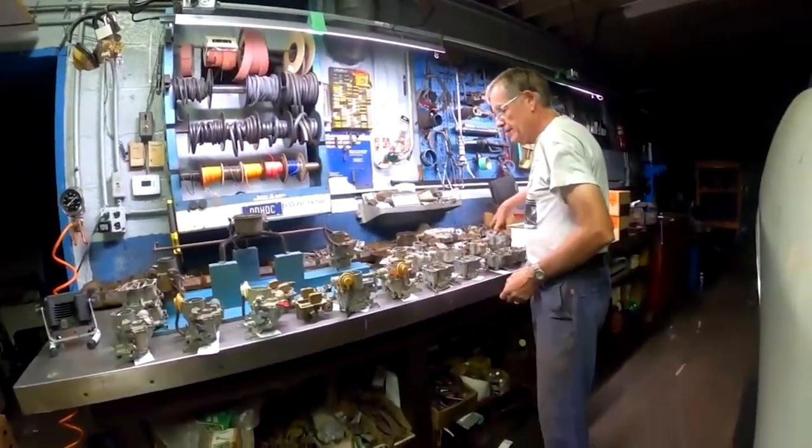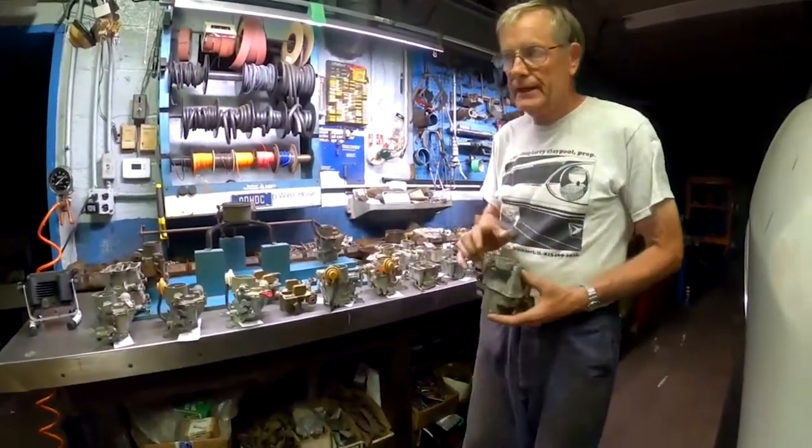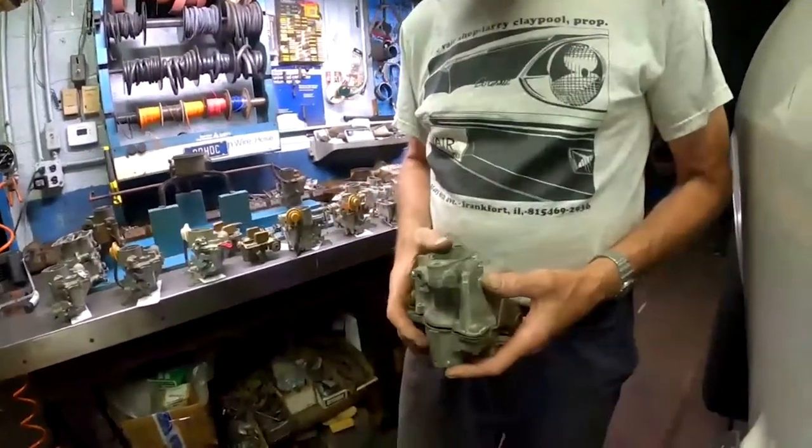And the last change that they made on the secondary carburetors was, since they had brought the secondaries out, like I told you before, it has only a power circuit. You stomp on the gas, it just goes wide open. There's no idle circuit, no choke, no anything else. The problem with that is people who never floor it. So grandma's got her 140 automatic Corvair and she never goes over 40 miles an hour and certainly never puts her foot on the floor.